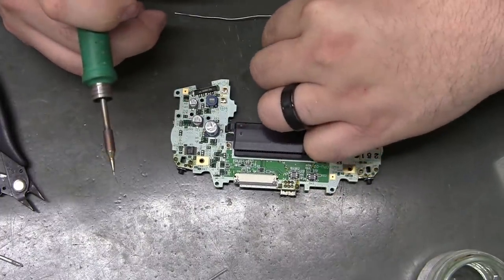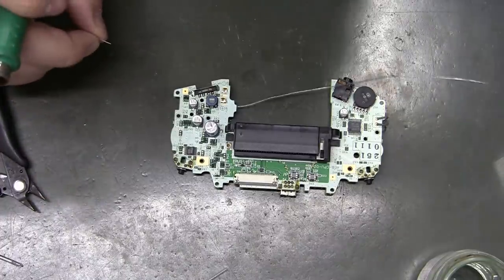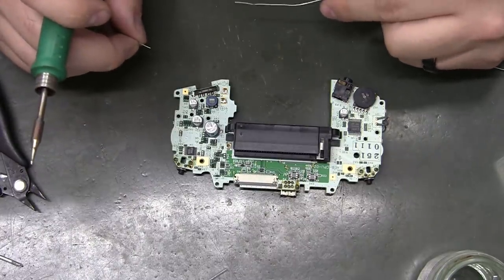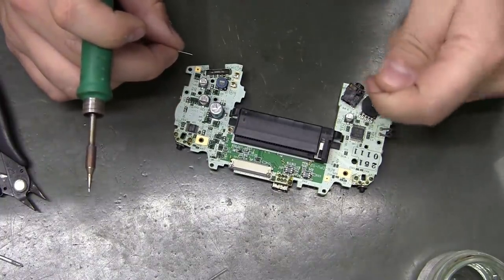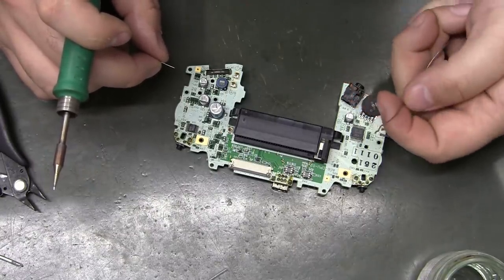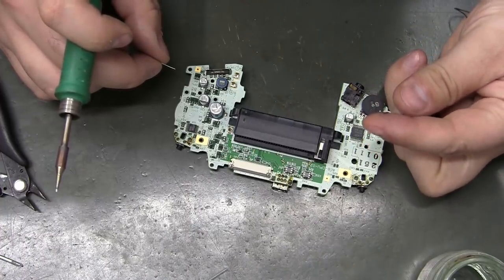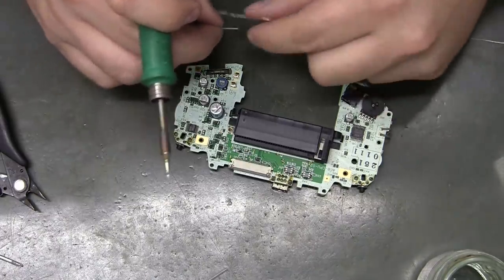Core solder. And I'm sure it's 6337. The label is gone, otherwise I could tell you more details. Like, I want to say 66 might be the type of core, what type of flux the core is. And I want to say there's another number. No, 245 was the type of flux, and I want to say the 66 was the percentage of core versus alloy. And I'm sure this is 031 diameter, which is about what I've been using for a long time.